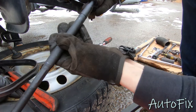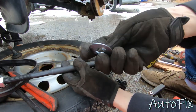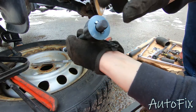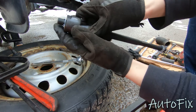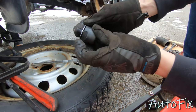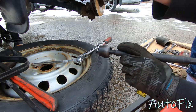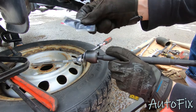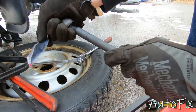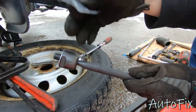So again, I'm gonna link new tie rods in the description. They should come with the locking clip if you buy the ones I have, and you wanna put that on before you install anything. And at the end, we're gonna have to bend it over onto these little slots right here. If you notice right here, it's actually not greased yet, but it does come with a pack of grease that you can insert. And we're gonna do that after we install it in the car, because you can try to spin this, but it's gonna be very, very difficult to break this loose at this point when it's not mounted.